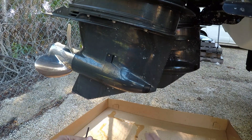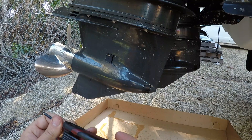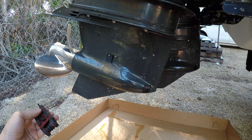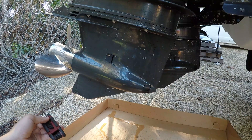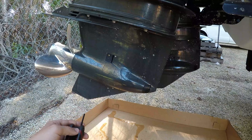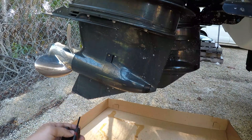For starters, we're going to take off this little cover. It looks like it uses a 5/32" allen. That's the one that fits the tightest. Definitely want to make sure you get a snug fit because it's a little allen deep inside there — if you round it off, you just made a job that was pretty easy take a whole lot longer.